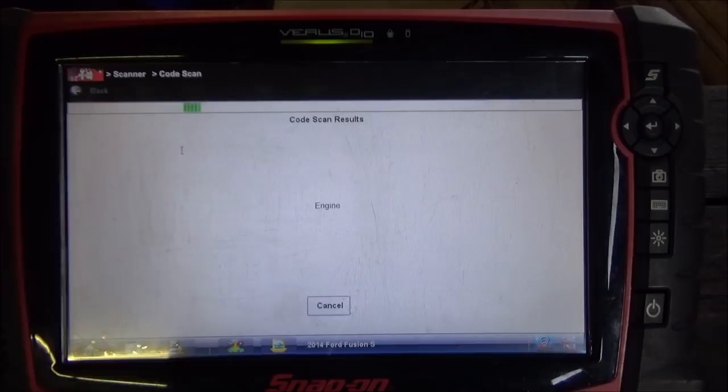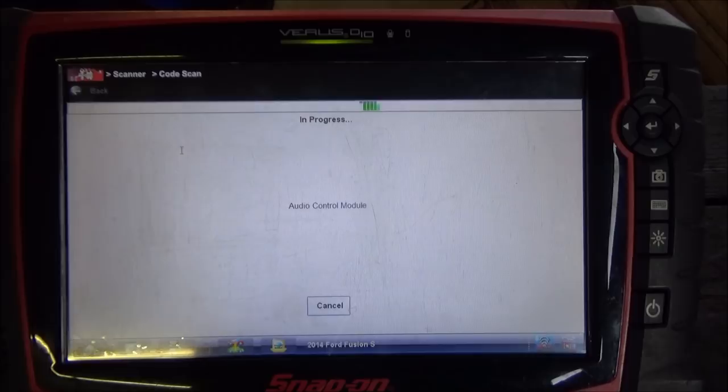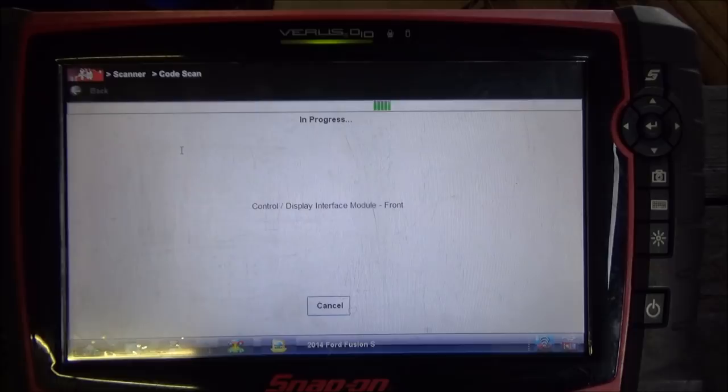There's our vehicle — 2014 Ford Fusion. To start off, let's do a code scan and make sure we don't have any crazy AC-related fault codes in memory, because that could definitely give us direction on what sort of issue we're dealing with. Ideally, when we're dealing with AC problems, we don't want to see any fault codes. If we don't see any, that's going to point to potentially an undercharged condition, maybe a compressor issue. But if we do have fault codes, we'll definitely want to take a deeper look.